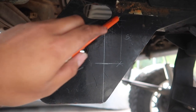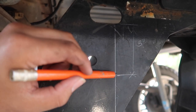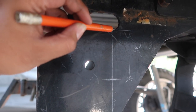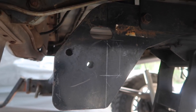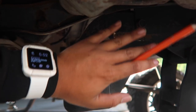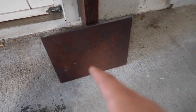When we grind this whole area to take the paint off and prep it for welding, all of these marks are gonna be gone. So our notch over here, three inches up, is gonna end up right here, and then we butt-weld this piece and this piece - this side and the back side - and then throw on our reinforcement plate over both sides and weld around it. That's plenty strong. Shoutout to James for this piece of metal - thanks man, came in clutch.